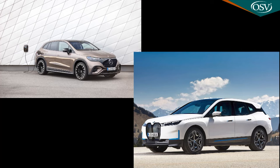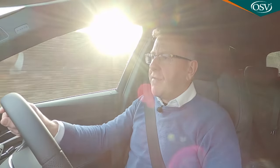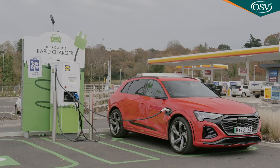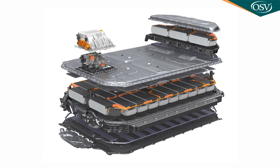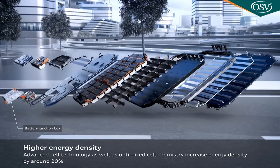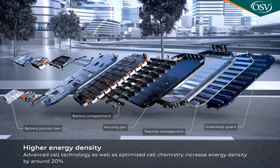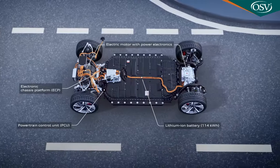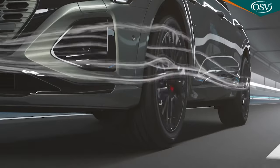Like its two German premium brand rivals, Audi still hasn't switched to an 800-volt electrical infrastructure. For its EVs, the lower-tech 400-volt system continues here. We gave you the mileage range figures in our driving section, these stats enhanced not only by larger battery sizes, but also by a 20% increase in battery density and a revised stacking process within the battery structure with altered electrode placement. The new, more efficient electric rear motor and the car's now more slippery aerodynamics also help, of course.